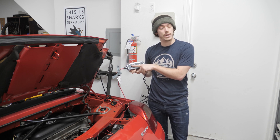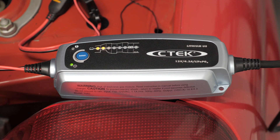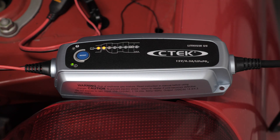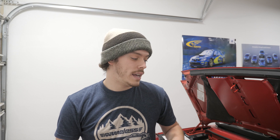You can now see status lights on the device showing what your battery is doing. This device is supposed to be pretty plug-and-play, and your user's manual will tell you exactly what all the symbols mean. Basically, just plug it in and let it charge up. The battery will continue charging over the next couple of hours. It also charges normally when you drive and the alternator gives a charge. It will hold its current stage until it reaches about 95%, then adjust until it reaches 100%, and then just keep it near 100% as long as it's plugged in. This is a great way to extend the life of your lithium battery.